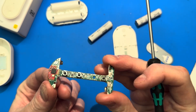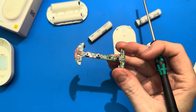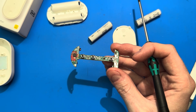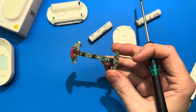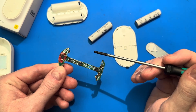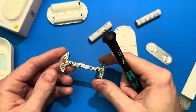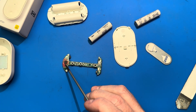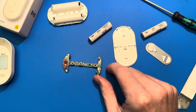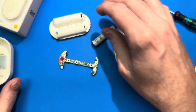This daughter board contains the little SoC that does the Thread communications. The SoC is also technically Zigbee compatible, and some people have been trying to flash the Zigbee firmware onto these to use different protocols. You can see those programming headers — those four pads — plus a couple of other test points and battery test points. It's so tiny. All there is is just that little chip on that little daughter board, and the rest is just buttons and passives for LEDs and sensing the button presses. Really, really impressive.